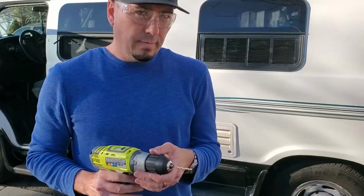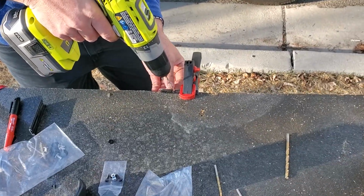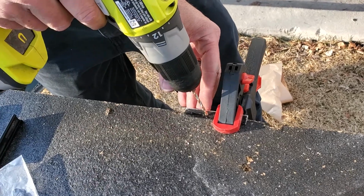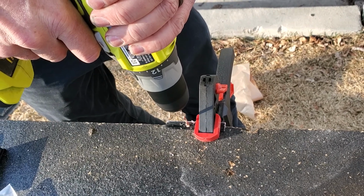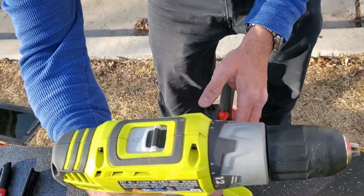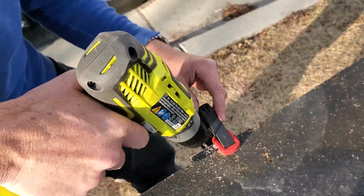Let's go bigger and record it on the other one. Okay, so an 1/8 inch screw, but we're using an actual 9/64 drill bit. And you want to just be careful you don't go to the outside edge. So if your marker is over here, you want to actually just move it over, pretty much center point on the bracket. And then after you do that, you want to just kind of oversize, and then see if your 2.5 millimeter screw fits. And this needs to be opened up a teeny bit more.